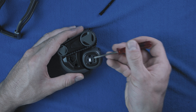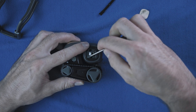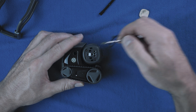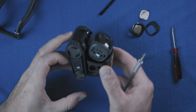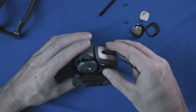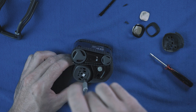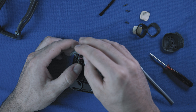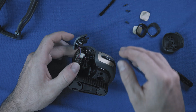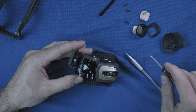I have some modifications there — more about it later. Now you can access the screws holding his head together. Under the speaker is the main connector, so unplug it and the head is off the Vector.